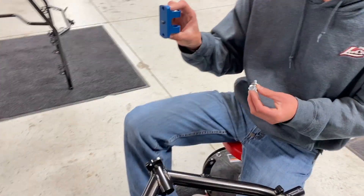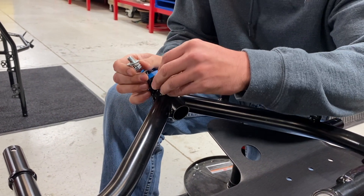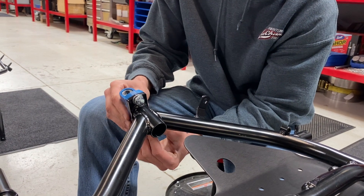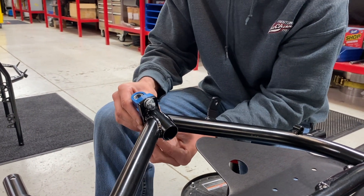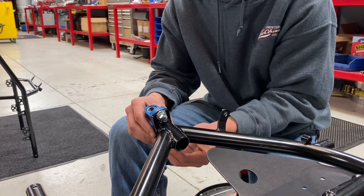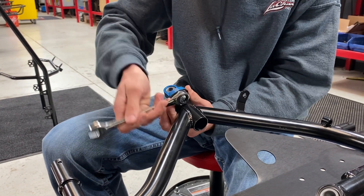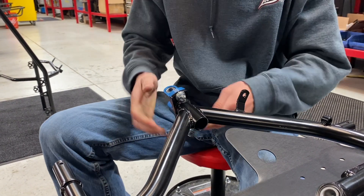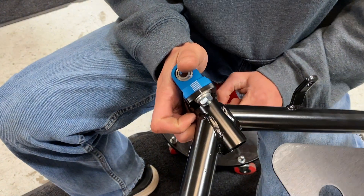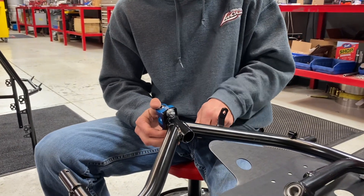Take the two-degree knuckle to the left front side with the thick part of the wedge to the top and put it on. This is one of those common things — especially at a place like Red Bluff — where these knuckles get torn up quite a bit, so people watching will probably replace these frequently. A question we also get quite a bit is where does the line go on the knuckle — it's pretty straight up, just straight up when building these cars brand new, and you'll be in a great spot to start.